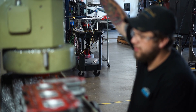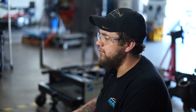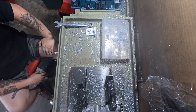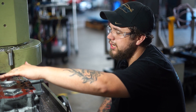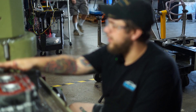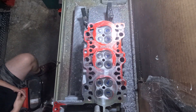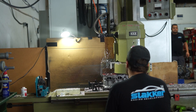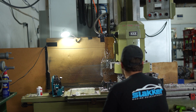So now we're touching and we'll make our first pass. The first pass we're just going to skim it from the touch-off point to see what we're working with, and to make sure we're not taking off more than we need to. You can also see this spot right here is almost always the high point on these heads. Now we're starting our second pass — this is going to be about one and a half thou. This should clean up a majority of everything on there, but there will be some spots where the corrosion was in between those water ports that are going to be low. It'll be really easy to see with the Dykem on there.